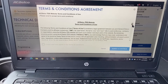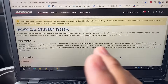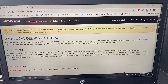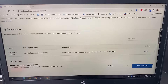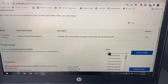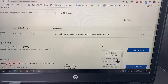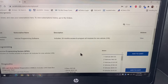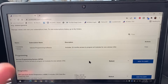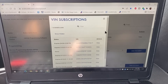Once you're logged in, you want to agree and continue. Then scroll down to SPS programming. If you click where it says select, you can see the vehicle pricing: one vehicle for $40, two for $80, three for $120 — basically about $40 each. What this gives you access to is 24 months for one vehicle and you get to program all of the modules on there twice. Because I already have a subscription purchased, I'm just going to click on view and then you can see I should have an open slot.